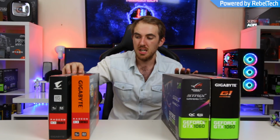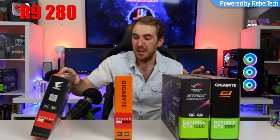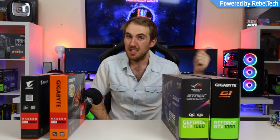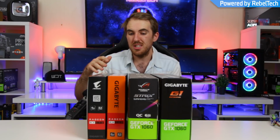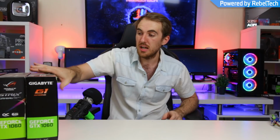Same with the AMDs. If you have an RX 500 series card, and then the other card is, let's say, an RX 280, that's going to be a bit of trouble, because a lot of times the driver versions don't work properly together. For instance, my 980 that I have inside my PC works much better on a much lower version of NVIDIA drivers, whereas the 1060s work perfectly with the newest ones. So just keep that in mind. Also, a big part of GPUs is to make sure you have enough power to actually power these. My 600 watt would be fine to handle these, but let's say you add 6 RX 580s, 600 watt would not be enough to handle that.